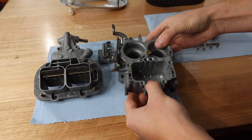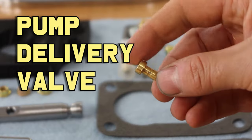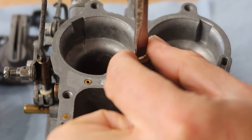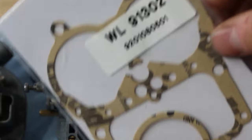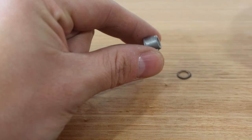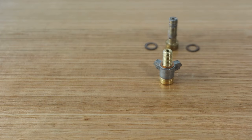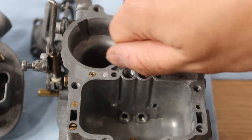If you've watched my previous videos you'll know that I've spent a fair amount of time cleaning the carburetor to be ready for reassembly. All of the new replacement parts you see me using here were part of the rebuild kit I got from Weber Performance — I'm not sponsored, I'm just sharing because I found it to be pretty good. This is part of the accelerator pump, basically a lift pump that engages when you first pump the throttle. I'm replacing the pump delivery valve and the copper gaskets. The accelerator pump jet will be reused and it's a 45, which we'll come back to later.